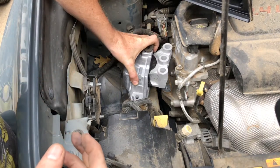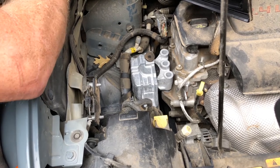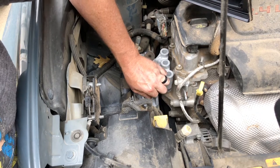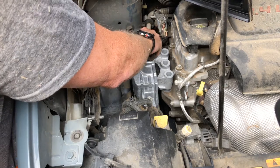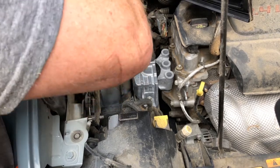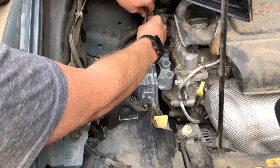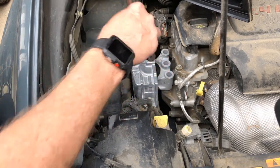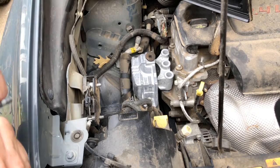So we'll get the new motor mount back into place. Let's start with the chassis side. Those are the shorter bolts, so those will be a little bit harder to get an angle. Plus, those look to be good and wide. So, get these over here and get them threaded in a little bit. Alright, get those threaded in. Just a little bit, still leave a little bit of play in there. And then let's see how hard it's going to be to line up the engine side.